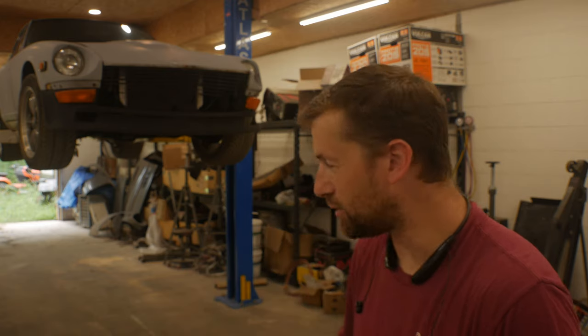And I spent 2 years in metal fab putting floorboards in it, putting a half cage, 4-point cage in it, built a subframe connector for it to stiffen everything up, stitch welded the entire chassis, epoxy primered the body, and then used Zero Rust, which I wouldn't recommend, on the chassis inside and outside. We'll go over that in a future episode, but coil-overs all the way around. This thing's got a ton of nice stuff in it, but it looks like crap, so...